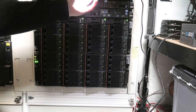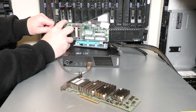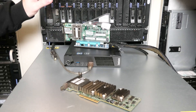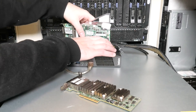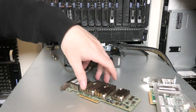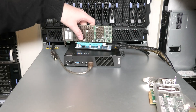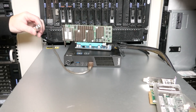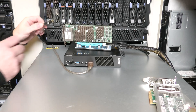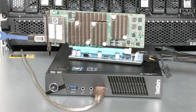So let's change the controller and get on with it. Here is the controller and we're gonna put it in over here. Disconnecting the disk shelves - the disk shelves are NetApp DS4243s. It's a very well used system; a lot of people have been using those for multiple cool projects. I'm gonna put this in. I have some limitations - my cable is only this long because this is a very special cable to go into the NetApp boxes and become 12 gigabit. They're kind of not that common and I was limited in the amount of lengths that I could get. But I think we're good to go and we can now try this out.